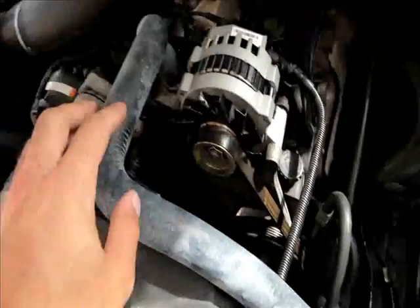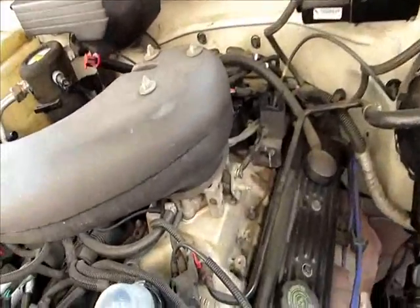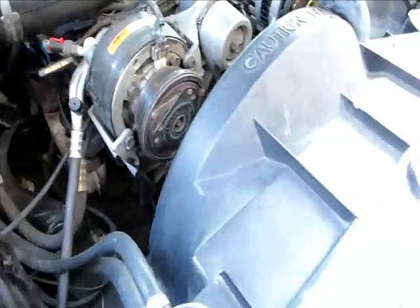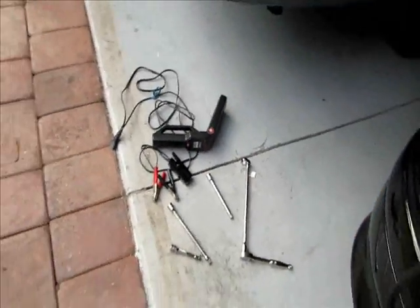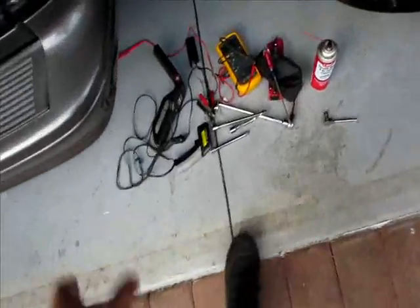Another thing — you know when the engine is hot, that's a good time to check the timing. When the upper radiator hose is hot, that's how you know you're getting coolant flow. If you don't do it when the engine is at full operating temperature, you won't get an accurate reading. It's about 90 degrees today in December so it's no problem, but if it's one degree outside you better let the thing warm up. That's how you set your timing — hope it helps someone. It's real simple on these trucks. These basic timing lights work, but it's better to get an adjustable one. These are like 20 to 30 bucks new or used — still works. It's also good for checking spark on any of these engines; if you get spark on a cylinder it's gonna blink, so it's a good tool for that as well.